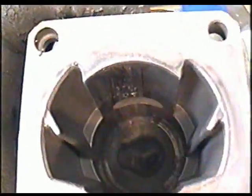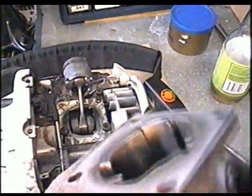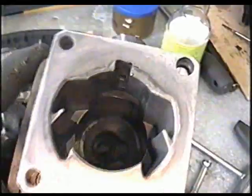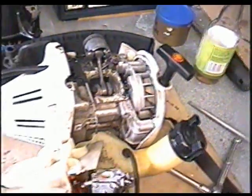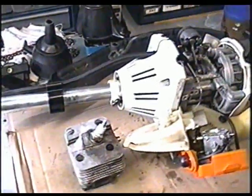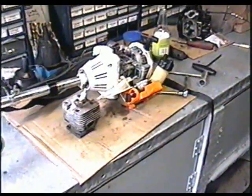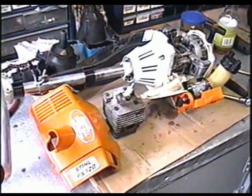There's the inside wall of the cylinder on the exhaust port. You can see it's scratched. And it's also scratched on other sides of the cylinder there as well. So that's what happens when you run your equipment with no oil. So I'm going to price the cylinder kit, which comes with the piston, rings, and the cylinder head. It is a $500–600 machine brand new to replace, so it may be worth fixing. So we'll see you later in my next videos.